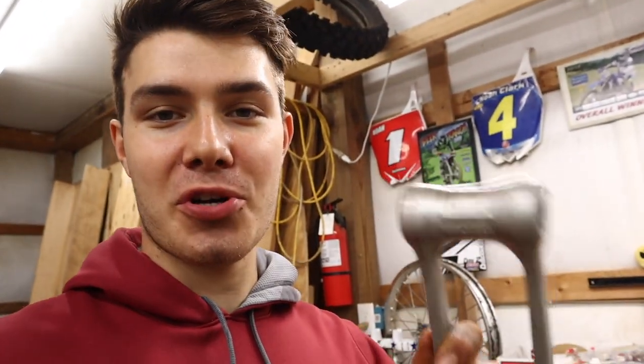Everything has been going way too well on this build, and so that brings us to this wishbone here. You can't push the bearings through, so you have to either use a blind bearing puller, which I didn't have, but now I do, so at least I got a tool out of the deal. Tried hitting it through with like a screwdriver and a punch and stuff. Did not work, just ended up breaking the races.